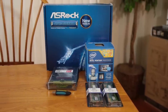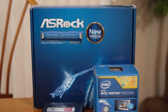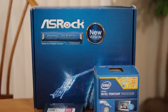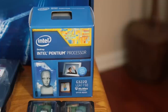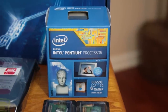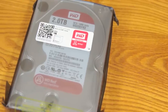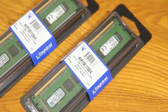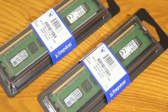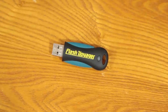So here are the components that I'm going to swap out. First things first, I've got the ASRock Server Workstation Mini ITX motherboard — the E3C224-D2I. This does support Xeon processors and ECC memory, so it fits the bill. Then I've got the Intel Pentium G3220, which is compatible with ECC memory. I'm adding an additional two-terabyte Western Digital Red drive for some additional storage. And then I'm using some Kingston PC3-12800 CL11 ECC memory — two four-gigabyte sticks. And finally, the flash drive that has FreeNAS installed on it already.